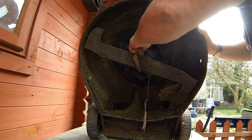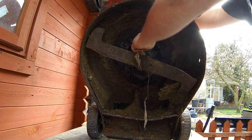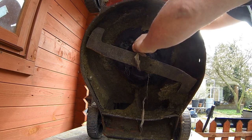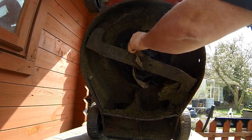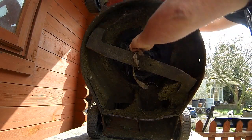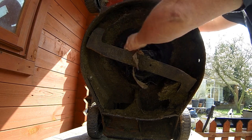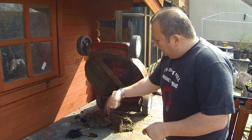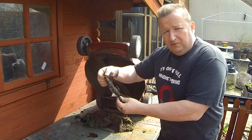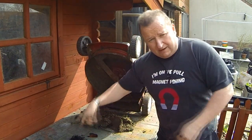All I'm going to do is take a blade and cut through this. It's just a matter of getting all these old bits of clothing — maybe old socks — because when you cut over by the washing line sometimes you pick up an old sock and that's what tightens up around the boss. I've scraped everything out now and I've got all the cable that was tied around the rotor — that's what was stopping it or making it go really, really slow.